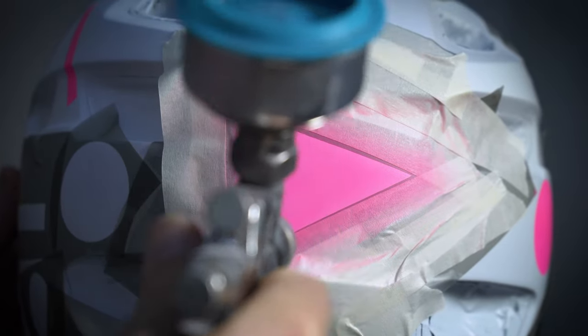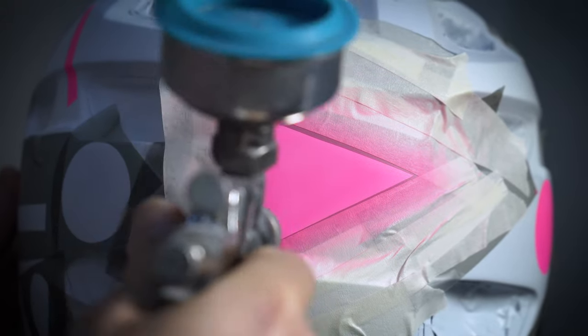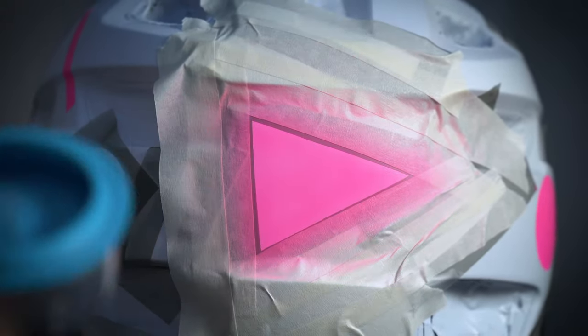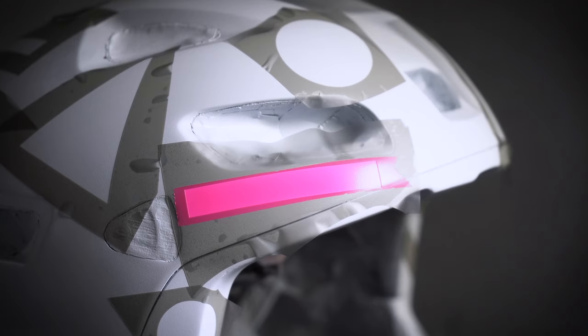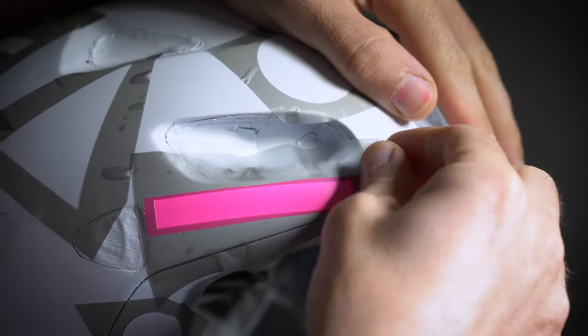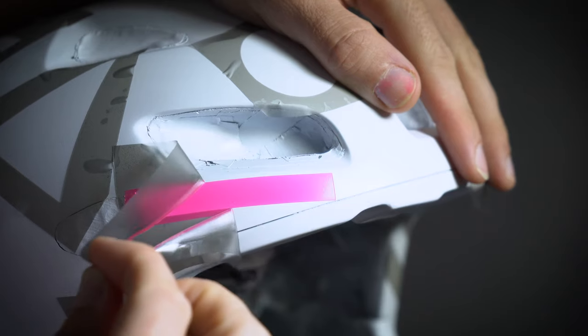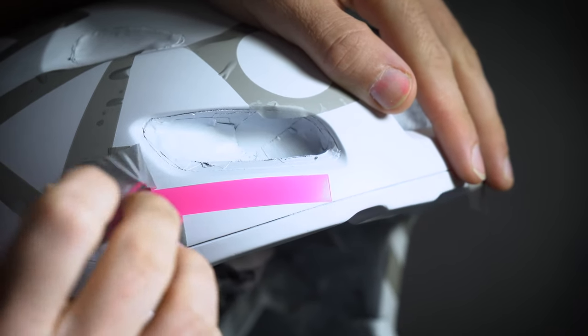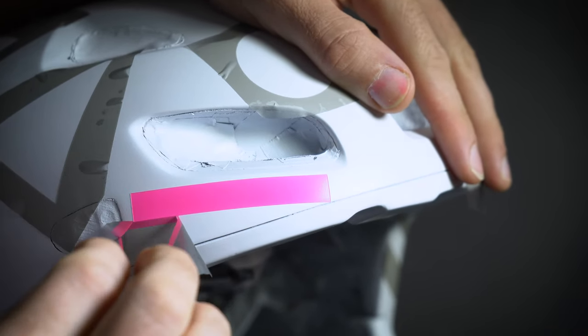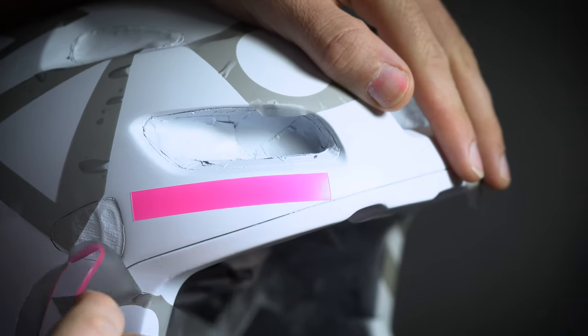Never just hoof the paint on — you will end up with too much paint on there. You can't control it and you'll end up with really heavy edges. You'll have issues with paint lifting when you de-mask. This is probably potentially five, six, maybe even more coats of paint, just really light coats. Then you end up with nice even coverage and, as you can see, it de-masks really nicely leaving really nice crisp clean edges, which is critical in custom paint.